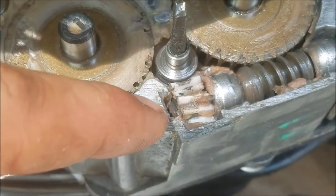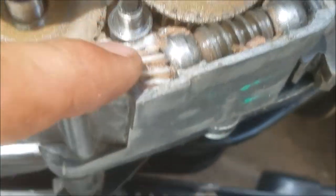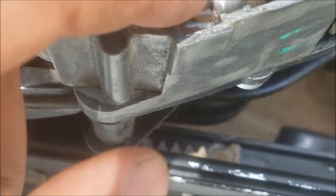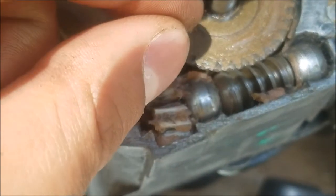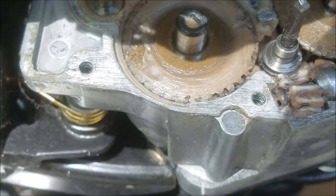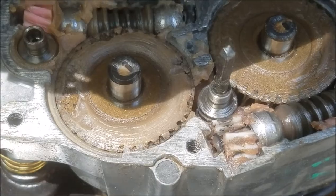Okay, so my gear is not broken into a million pieces, but as you can see it's missing a good chunk right there where it had broken up. So that's my problem — this isn't turning the plastic gear; the plastic gear has stopped making contact. Just got to replace that tiny little gear right there and we will be good.